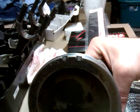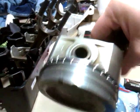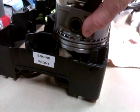That way you've got engine front marked and you won't mess up the orientation of the pistons. Also note that on a piston it has marks for the front — those two notches right there on this one — meaning the front of the piston goes towards the front of the engine.